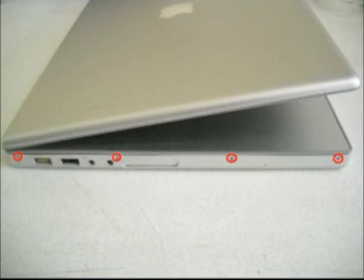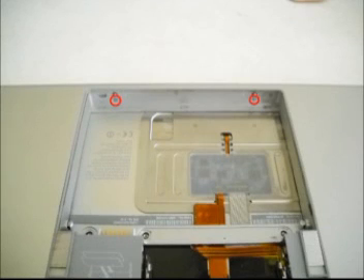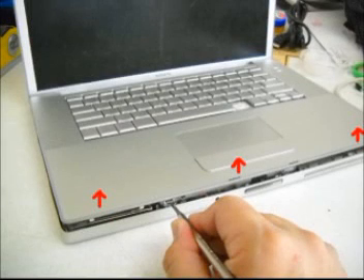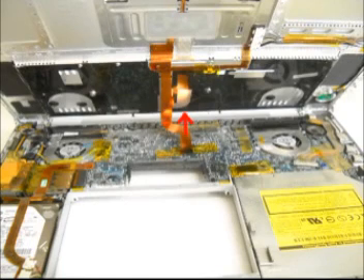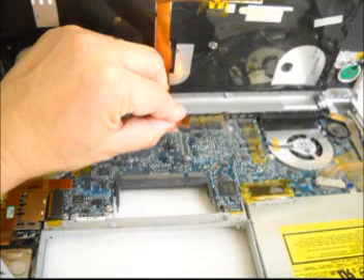Those are the side panel screws. That's the battery bay — it has two tiny screws there, you also have to remove that. And now I am carefully prying out the top portion which includes the keyboard. Underneath that keyboard is a flat ribbon connector. Take out the adhesive tape and carefully lift the connector.